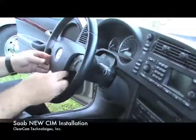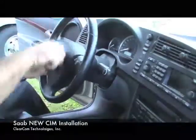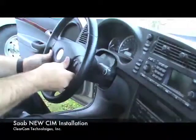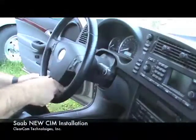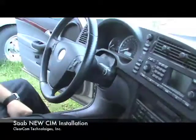Make sure that the sides — the rubber sides of the airbag — clear the radio controls. They usually hang up here, so you have to work them back and forth. But once they've cleared, take and snap the whole thing down. Make sure that it snaps at all three corners, and we are done installing.